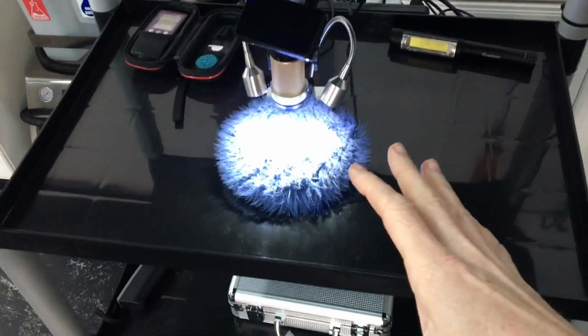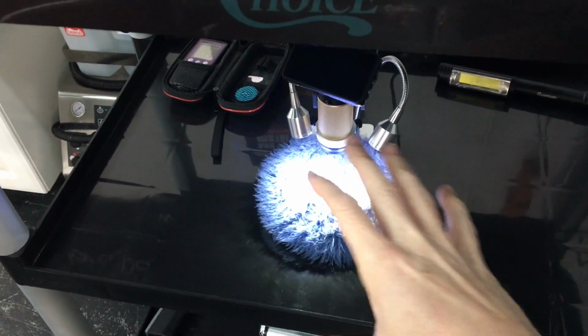Just to give you a quick visual, just to help those just starting out understand what I'm talking about, this is a wool pad here, and an up-close look will show each fiber. A clean pad, they are working independently. They are working as a team on the same pad, but you get a more consistent, cooler cut or polish if they are clean and working independently of one another. And here you can get a quick close-up as to what each fiber looks like. Very interesting, and I'm going to do a dedicated video on all different types of pads, what they're used for, what they look like up close, their purpose, and what they go best with when it comes to a compound or a polish. Now let's take a look when the pad is clumped up.